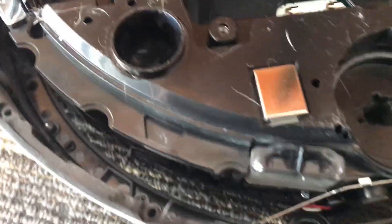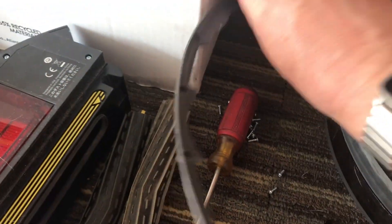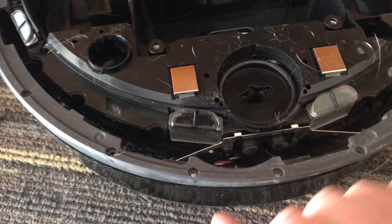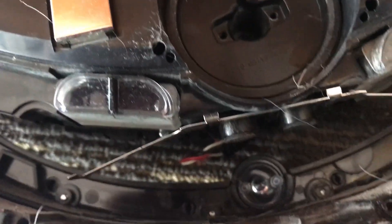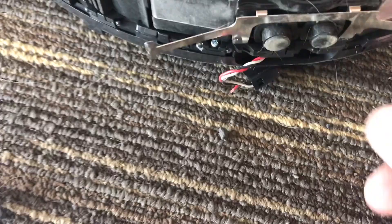The vacuum cleaner is upside down — this front unit sits like that and the entire thing is held on with 10 screws on this plastic clip. Basically you take out those 10 screws, lift that off, and this whole thing will come loose. You'll then need to take out the two screws holding the sensor.